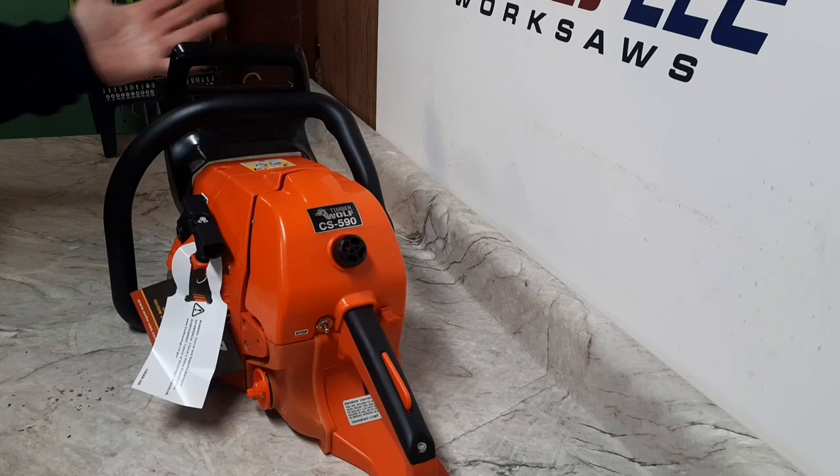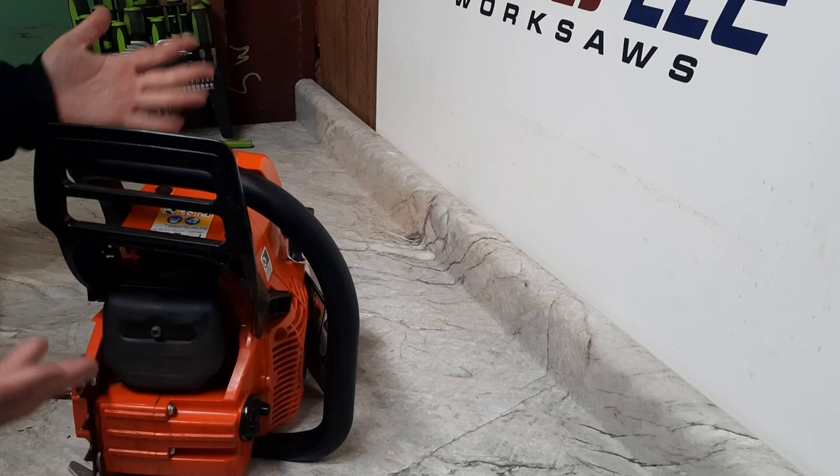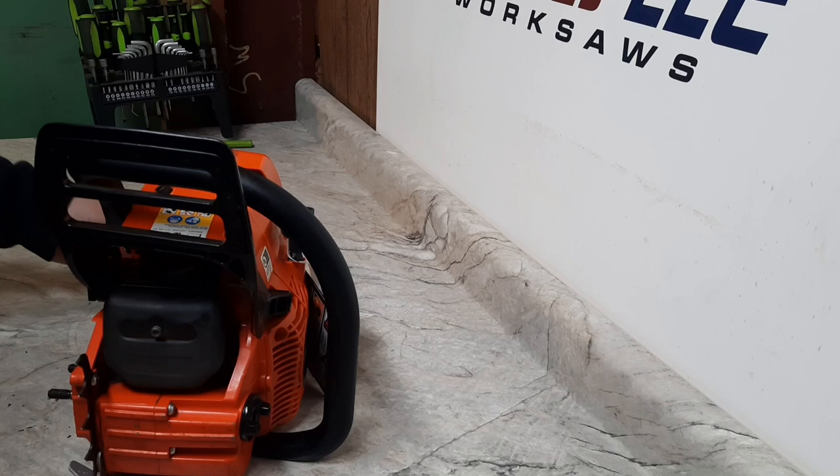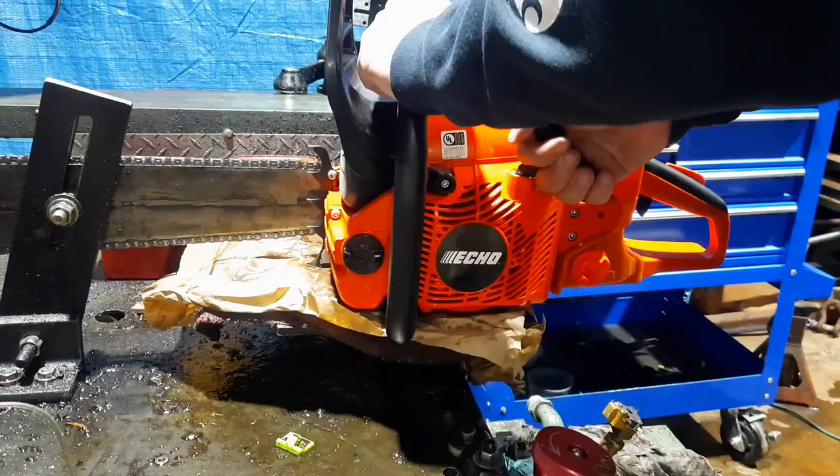At least this one fires up, so that's a good sign. Maybe there's not a ton of time on the bottom end, but just looking at the front of the case and the spikes, it's definitely not brand new. I'm going to guess the cylinder is the same. For whatever reason, they just put all new cosmetics on it to sell it for half the price of new. The tank even says May of 2021, so it's not a super old saw. Either way, we'll get it bolted on the dyno, get some baseline runs, then put the muffler outlet on and the advance key.